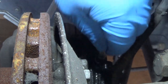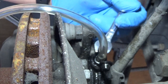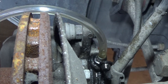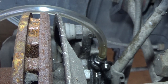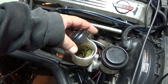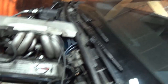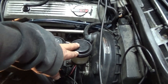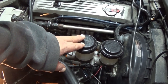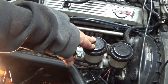Let's see what happens now. No air bubbles. No air bubbles. All right, the brake bleed is done. All four corners — starting at the right rear, then going to the left rear. This is the rear reservoir for the rear brakes. Then coming to the right front and then left front, and this is the brake reservoir for the front brakes.